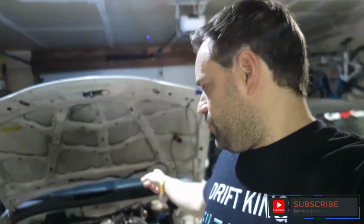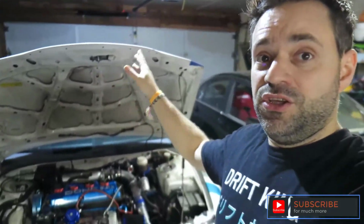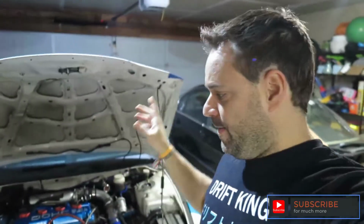So I really hope this video helps you. Watch the other videos, because if you're replacing the ECU and putting a Speeduino in your Eclipse, and honestly, I couldn't find anything about Speeduino in Eclipse. There's a bunch of MegaSquirt, and I believe that this is the first Eclipse documented using Speeduino, and especially Speedy EFI. There are things when you cut your ECU that you need 5 volts and you need 8 volts. So some of the sensors are 8 volts controlled, and it's a pretty cheap situation. You just buy a pretty cheap part on Amazon, and just solder, or even you don't need to solder, but soldering, it won't come off, right?